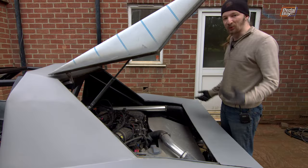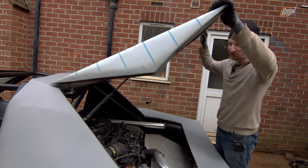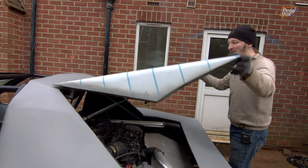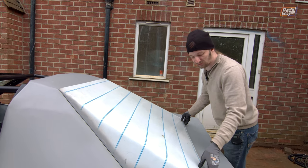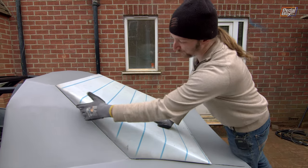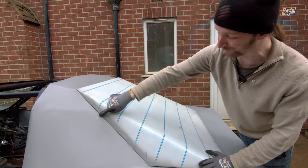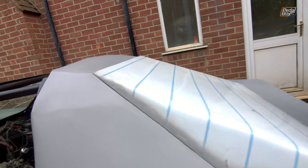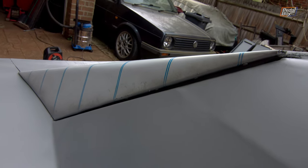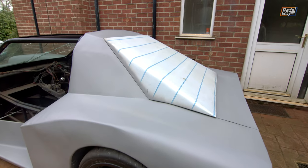I really love this engine bay cover. We've even added a gas ram so we don't need props to hold it up — it closes really nicely. To fill the gaps between the cover and the rear panel, because we didn't get the sizing exactly right, we've used the welder essentially as a 3D printer to build a lip off the entire rear panel to take up all that gap. It's looking really nice on this side and we think we can mirror it on both sides quite easily.